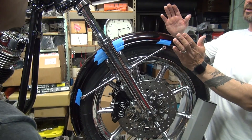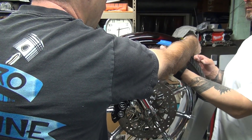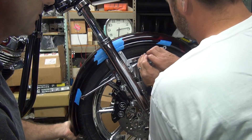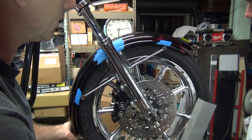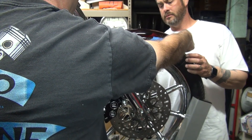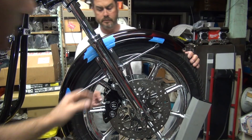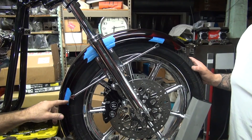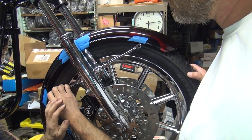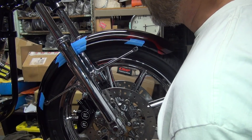The whole fender is going crooked. First priority: get the two center ones mounted and get the fender positioned top to bottom. They're about equal front to back now. One bracket needs to be bent down — they bend it. It looks better. They check both sides for equal clearance, noting one hole is slightly off. You can't be afraid to modify stuff. After bending the bracket, it lines up much closer — they get the fender attached without jiggling it any.